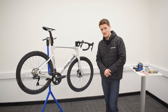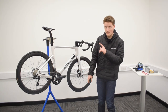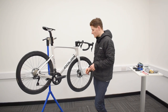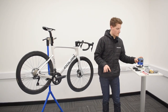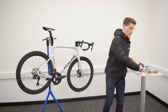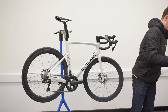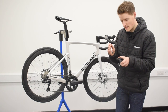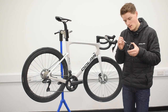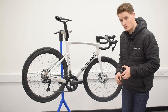The Dolan Ares road bike is nearly ready to ride — nearly, because there's one key aspect still missing from this build: pedals. Today I'm going to be fitting a nice shiny new set of pedals. For this you're going to need a bit of grease; most pedals will need an 8mm allen key but the ones I'm fitting today need a 6mm, so it's worth checking which one you need before you start. Get a small brush — an old paintbrush works well — dab it in your grease and gently coat the threads of your pedals on both of them. This is so the pedals don't seize in the crank holes when you come to remove them in the future.